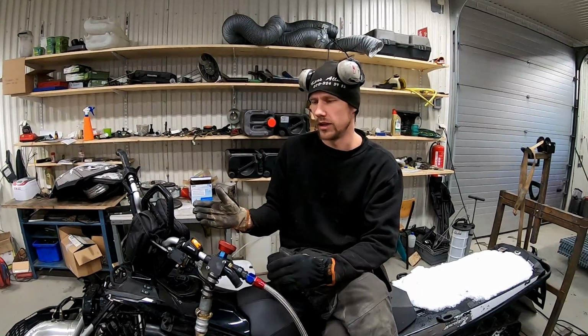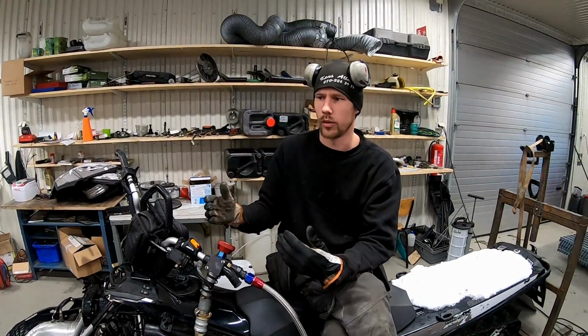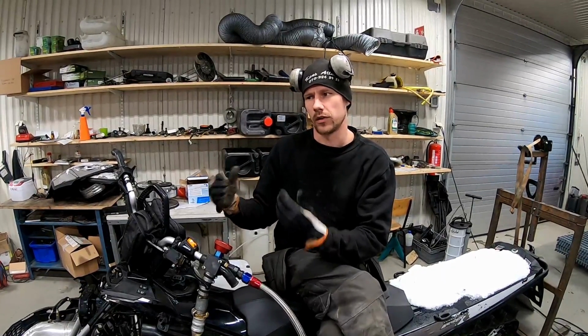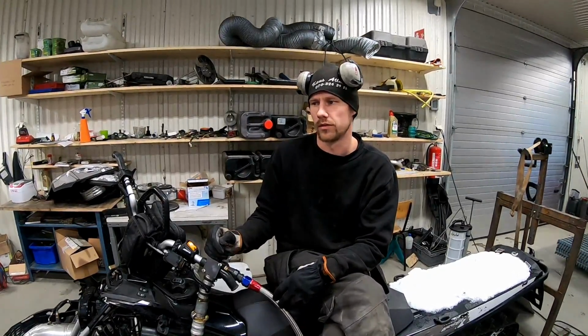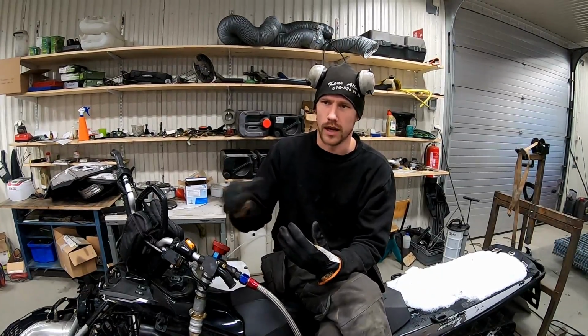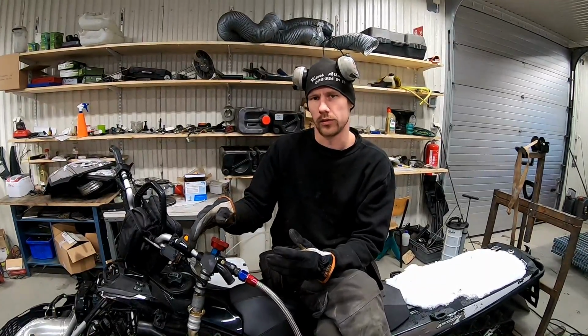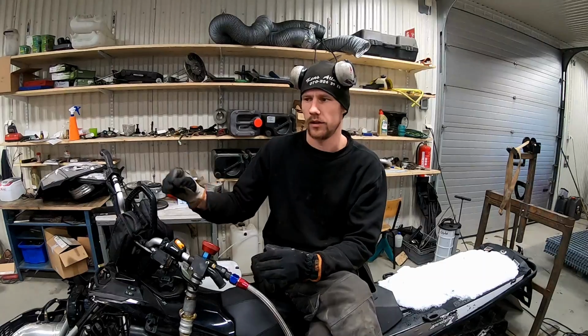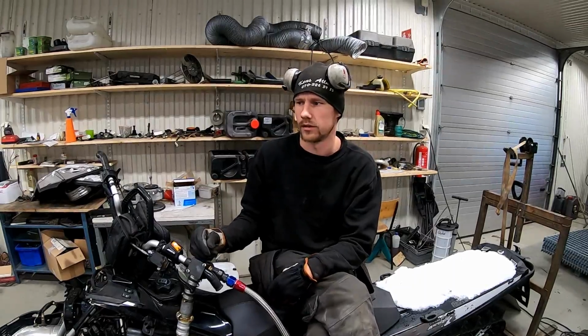So that's why I raised the ignition 1 point. And we're going to try to tune the pipe so it peaks at 8000 RPMs, because we can't go any higher when the ignition goes down so much after 8100. I can't raise the ignition only on the top. If I could do that, I would easily pull it to 8100 or 8200, but we can't do that, so we just have to go with what we got.